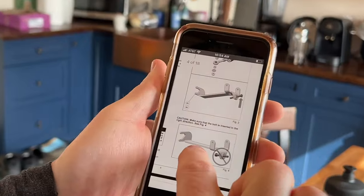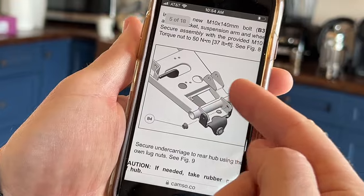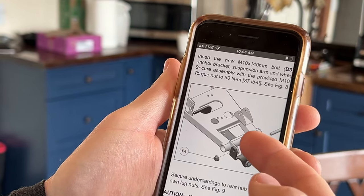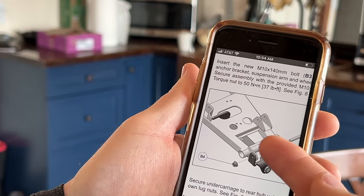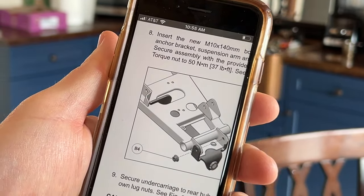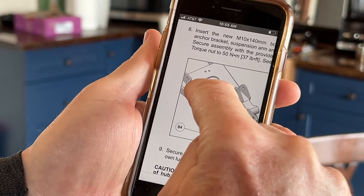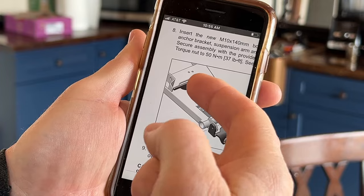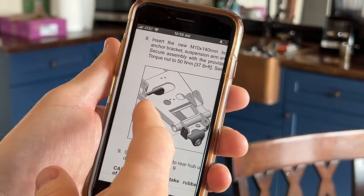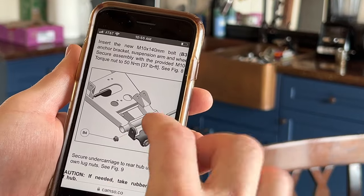This is the bracket we're talking about — it bolts right here near the brake housings and brake calipers. You take out the bolt that attaches the axle to the control arm. But this control arm, where they documented it in the diagram, looks nothing like the one on our machine. There's a bigger open space with a couple of bracing triangles, and this piece hits right where the bracing triangle is, so you don't get enough bite — it doesn't fully engage the control arm.